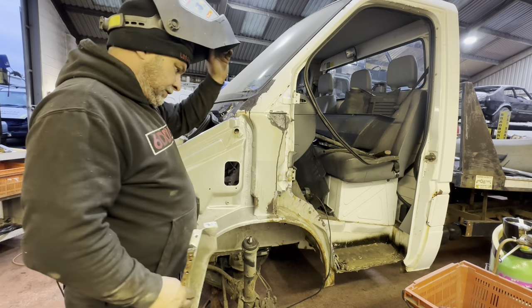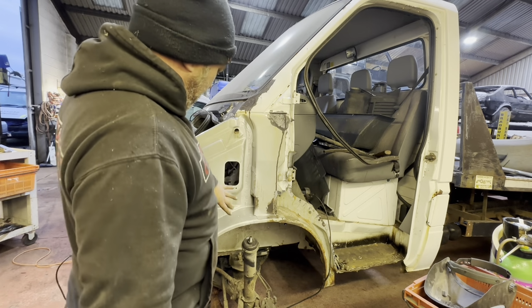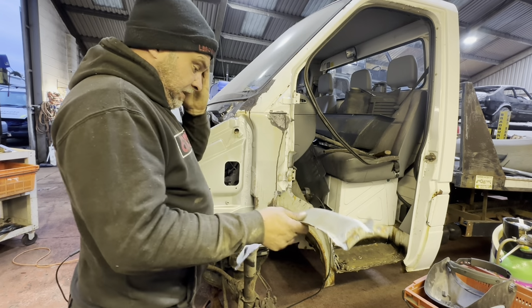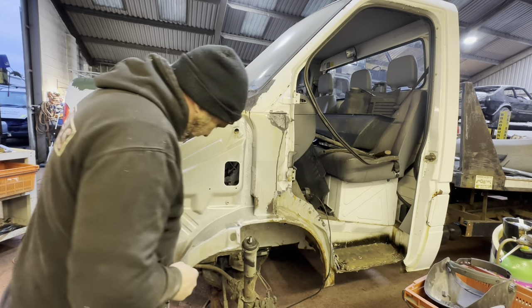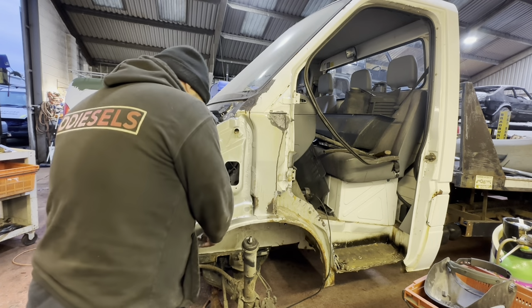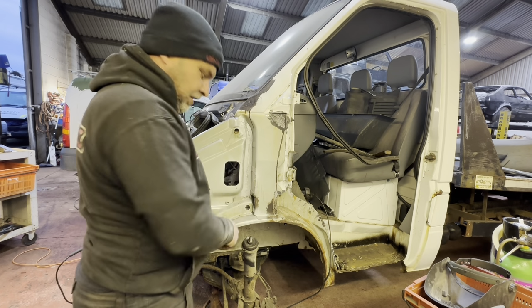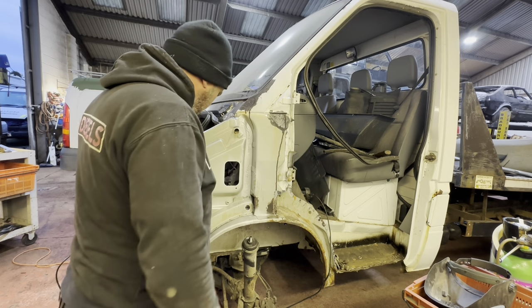Right, so as well to take my welding helmet off. I could spend hours cleaning it up, but we're on, we're attached, that's pretty tidy. And let's be honest, once the wing's on, I'll seam that, that's weld through etch primer, because we've cleaned up all these spot welds, because we also have this bit to put back on. That goes there. But obviously we've got to fill in this hole in the bottom of the wing, the bottom of the door pillar that I've just cut out.